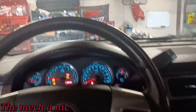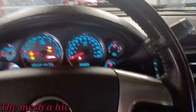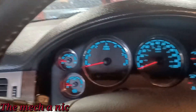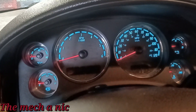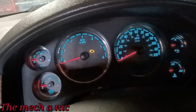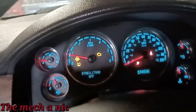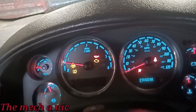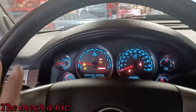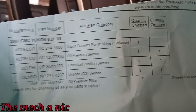Today in the garage I've got a 2007 Yukon — whole Christmas tree of lights on. One thing I experienced right now that I didn't really know about is the car not wanting to start. It's a crank-no-start — it wanted to start sometimes but it just wouldn't catch. I had to attempt to start it like four times. It eventually started. We have to change an oil pressure sensor — the oil light just came on and we get a low oil pressure warning on the dash. The owner just wants the parts put on: oxygen sensor, camshaft sensor, oil pressure sensor, and a purge valve.